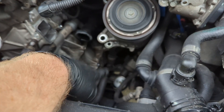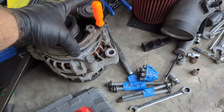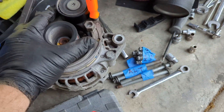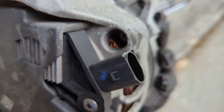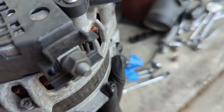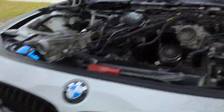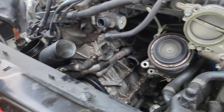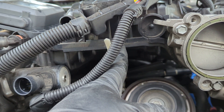Normally you have an alternator here — this is the AC compressor which sits below the alternator. The alternator comes out with two bolts, and just make sure you unplug it. You've got one plug back here, and then you have your actual wire that goes to the battery. Make sure you unplug those and make sure you undo your battery to your car first, otherwise you'll be arcing on stuff.